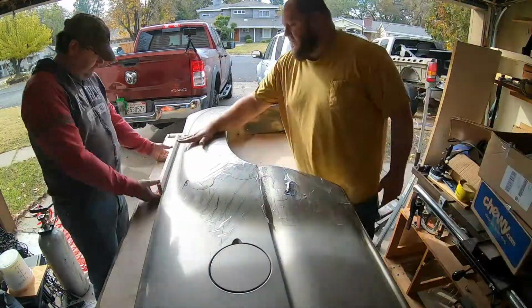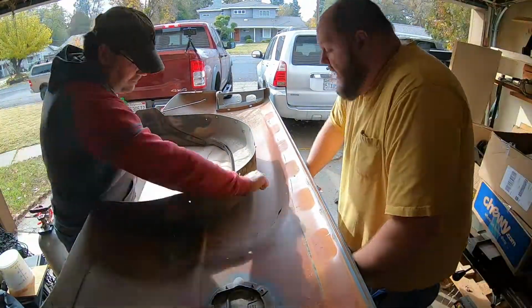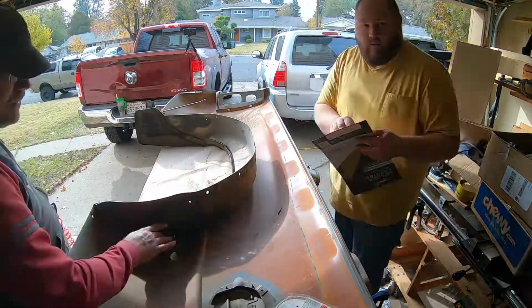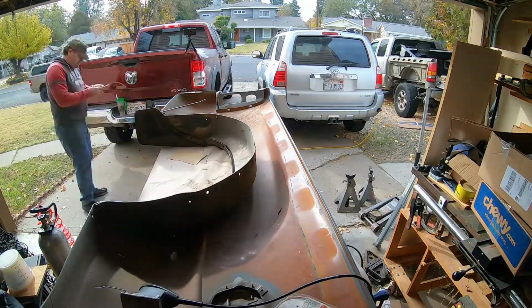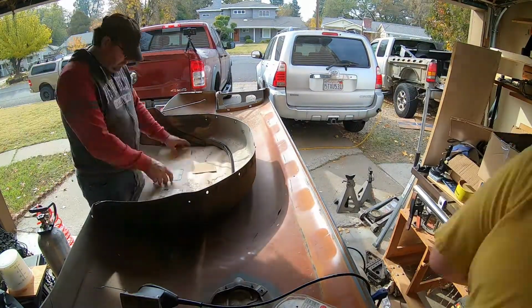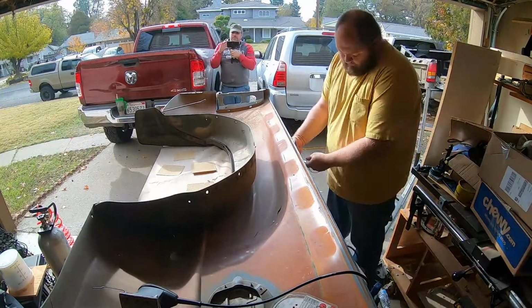We're currently at the stage after we've finished taping the panel back together. We're going to go ahead and start roughing up the back surface. Now, we're using 80 grit sandpaper. And because this is a composite plastic and not a fiberglass, I didn't feel like I really needed a mask. Though, to be fair, I probably should have used one.